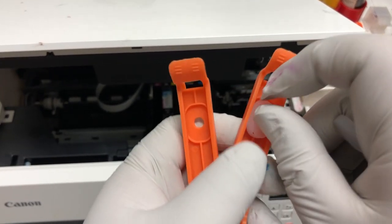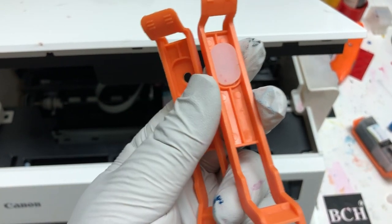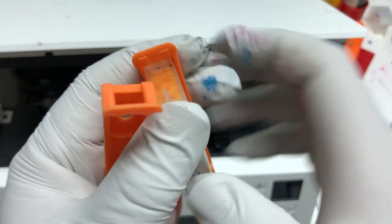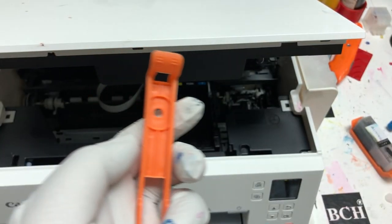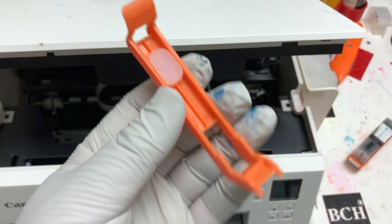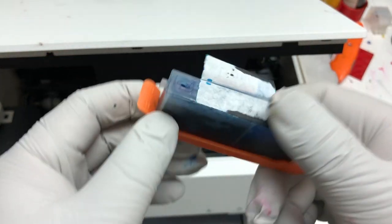Let's put a silicone pad on the protective clip first. For the cartridge, put the tab inside that hole, and then press it down in the front. Let's see it again: pad, loop, press.